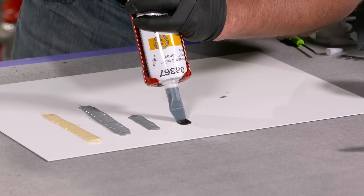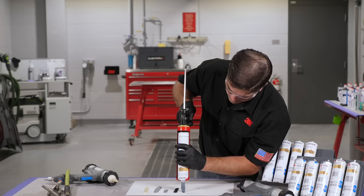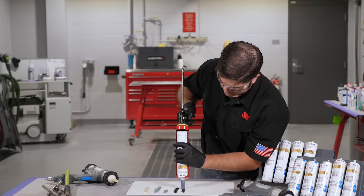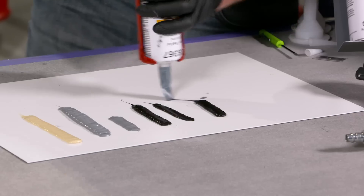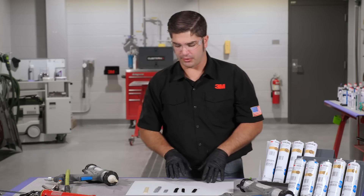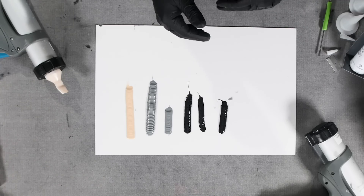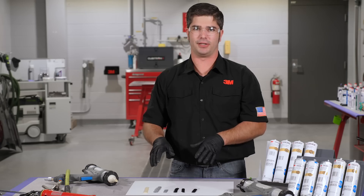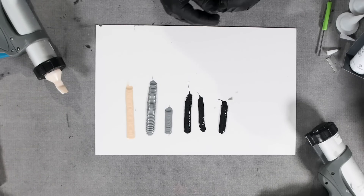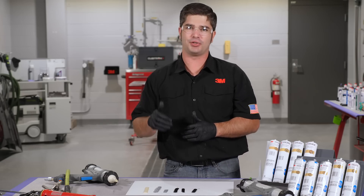With our one-part hand caulking applicators, depending on what you're going for, you can go narrower. If you've got a taller bead you can make it a little bit taller, and again we're creating a tight seal to the surface. One misconception people have is that one-part products really take a long time to cure. That may be correct in some instances, but what they miss is that you can actually start painting our one-part products in 30 minutes — it doesn't need to be fully cured. So using some of these techniques we can accomplish that ripple bead with a variety of products, create a 100% seal to the surface, and complete that corrosion resistance seal before it gets painted.